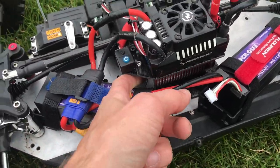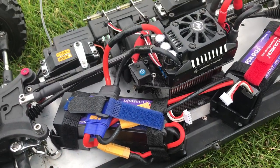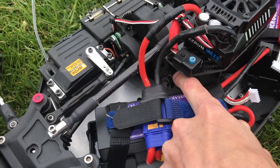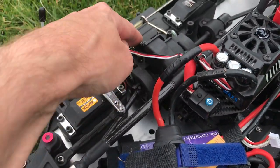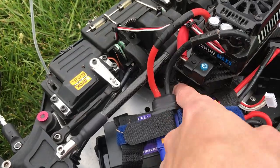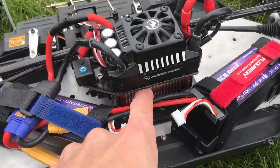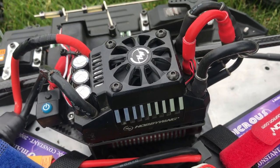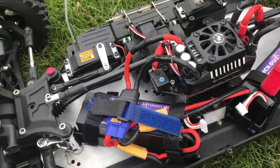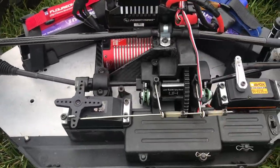To save on weight and space I made my own carbon fiber Kevlar motor mount, which I've used in another car — it's tried and tested and stands up well. I'm running a 16-tooth pinion and the spur is a standard 160-something — I forget exactly, but there's space to move up to a higher pinion. On this setup a 16-tooth is preferable. This is a Leopard 910kV motor, which is what I'm running today, and it's been absolutely fine — all the diffs and everything are working as they should.